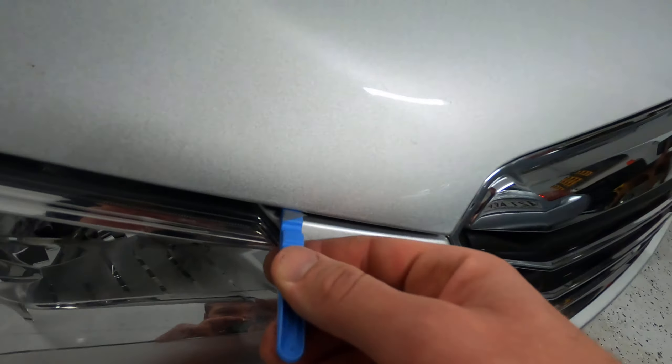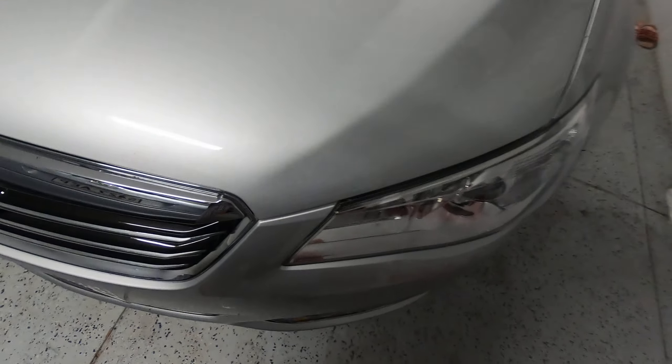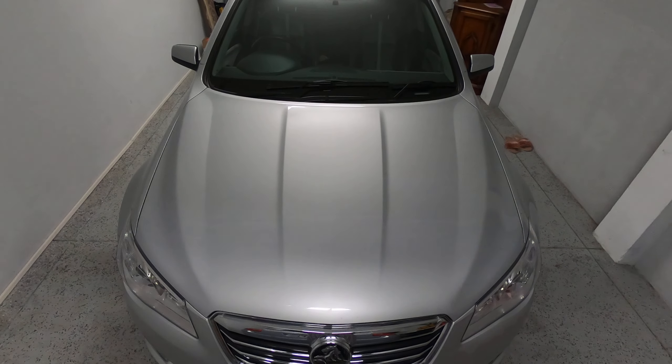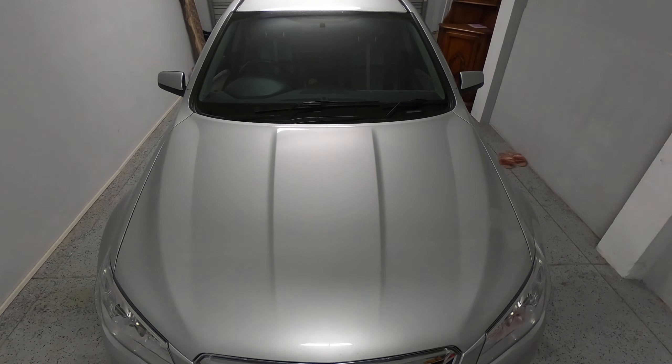After playing around with it, I pretty much got it ideal. I was doing about half turns — I did the outside ones first and then the inside ones. What helped was using something wooden or plastic, not metallic, because you'll scratch the panel or the plastic cover. I put a little bit of sticky tape or duct tape to mark how far the peg actually goes in.